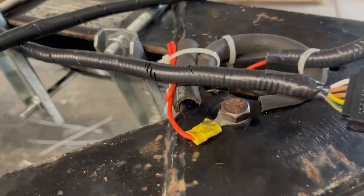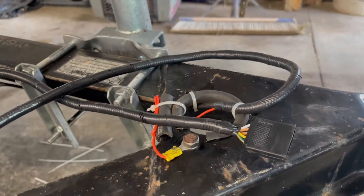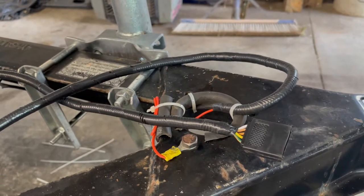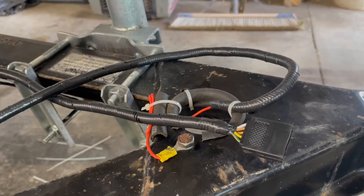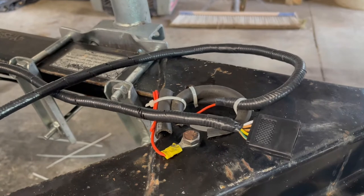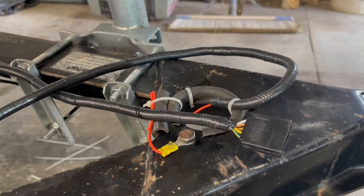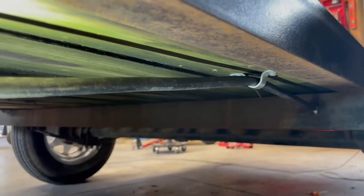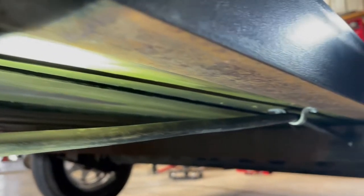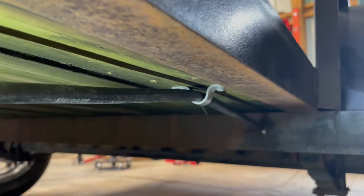I also added a little extra wire for the ground, since those can go bad or break. Any places where the wire might rub on metal, I put a little piece of rubber hosing — I've had too many trailers with wire rubbing through on metal. I actually used an old piece of air hose as a wire loom, and surprisingly all four wires fit through it.